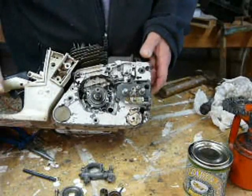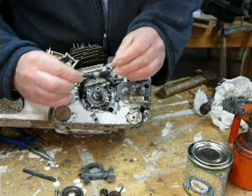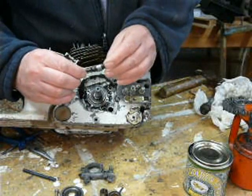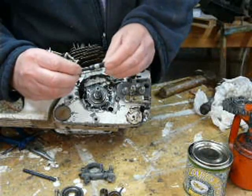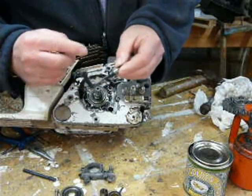Let's see if we can get this sorted. This is the pickup pipe and that's the filter. It's quite a coarse filter but it's been in the tank a long time. I did actually blow it out backwards with the compressor and surprising little bits of mop came out. So we know that the pipe's free.